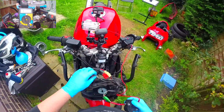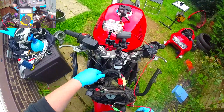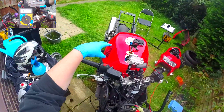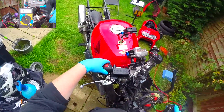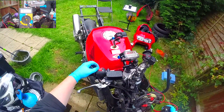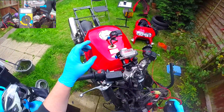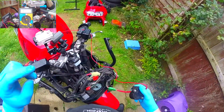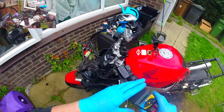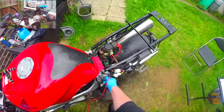While I'm at it, I'm going to check these plugs as well. I need to check the wires to make sure I've got no broken wires, no trapped wires, no pinched wires. And I'm going to have to undo this switch here and get to this switch so that I can look inside of it and see if there's any corrosion or anything inside that is causing some issues. So that is my first step — to check those bits.